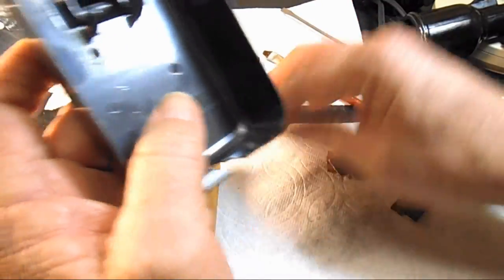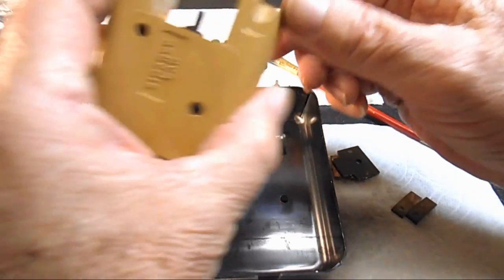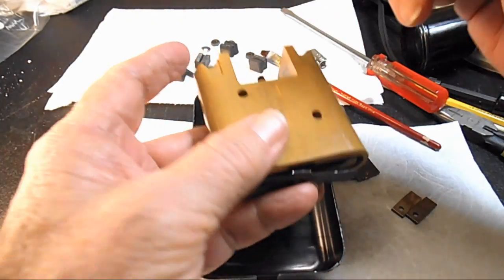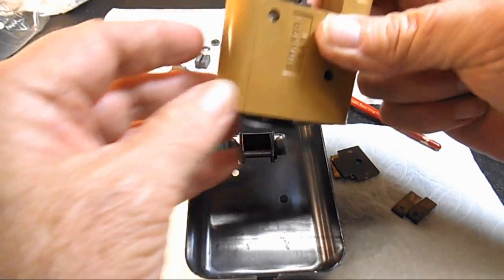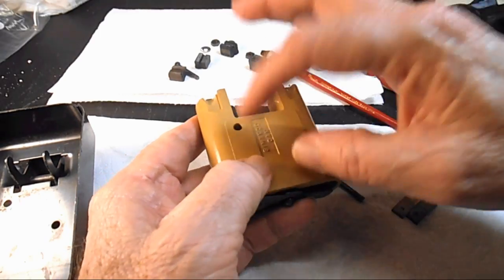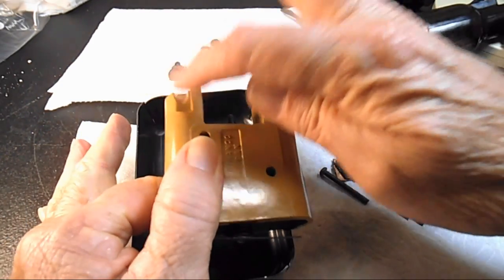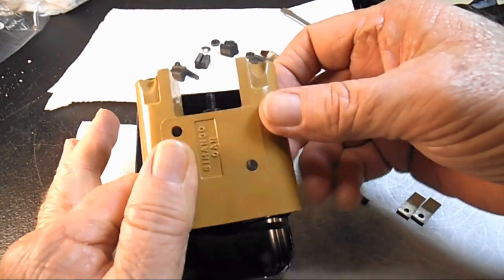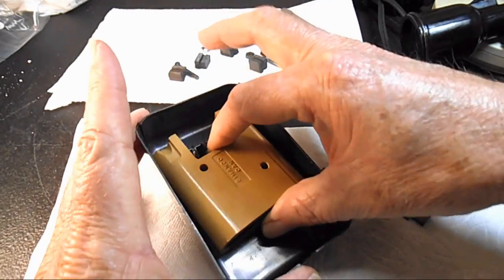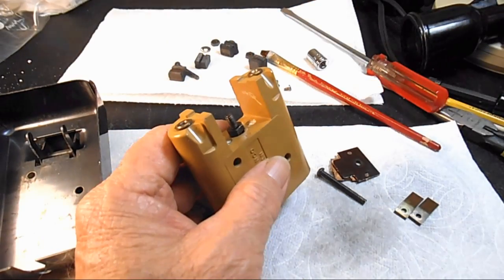This is different — there's no rocker arm. On the other type I would assemble the whole thing and put in two screws to hold it to the base plate, but here I'm doing it on the top cover. I need to reattach the cords first, because once this is mounted in this style I can't put the wires on or off. These have a recessed area where the wires come and turn the corner and are mounted on the front, so once this is in here I can't install or remove the wires.